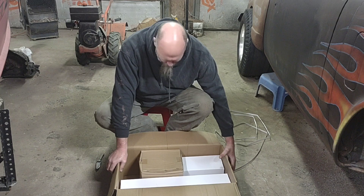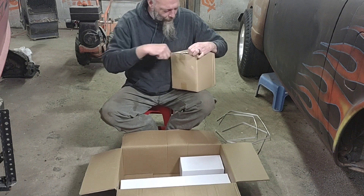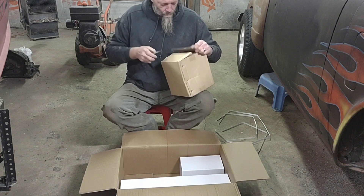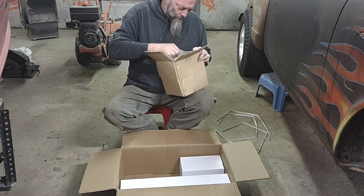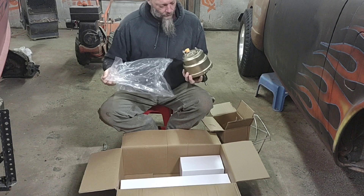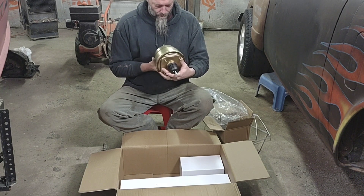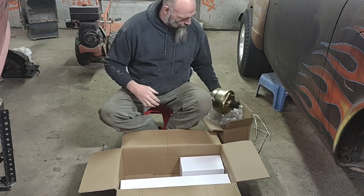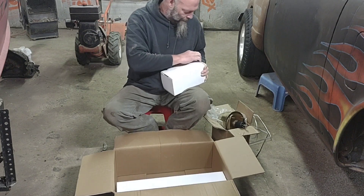This one I want to say was $149 or $139. This is for the brakes — it's the main part. This is the master cylinder brake booster. This is going to mount to the firewall. It's the smallest one I was able to find — I believe it's seven inches. So this mounts to the firewall like that, and that's where your vacuum plugs in and makes this work.